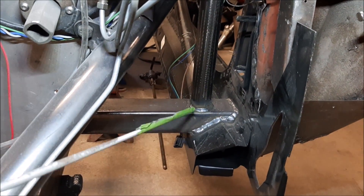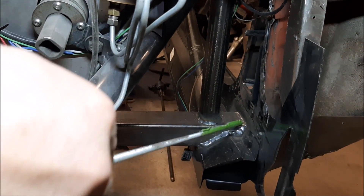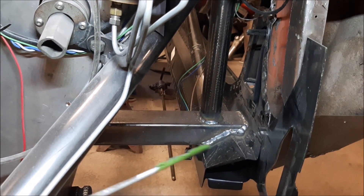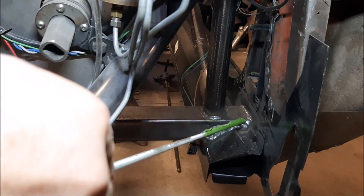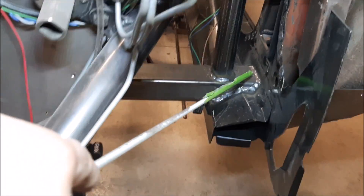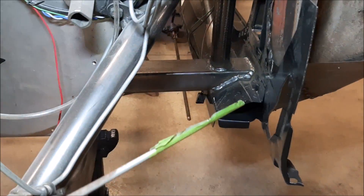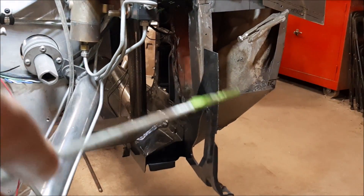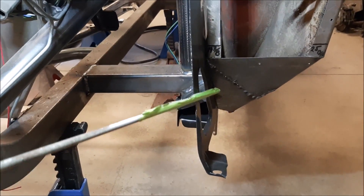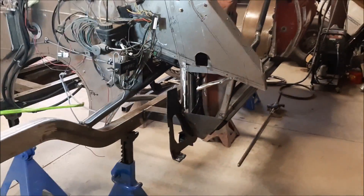You can see they've got this custom roll bar — we basically reinforced with stronger tubing, cut the angles perfect. The guys made patterns to match this rocker exactly, and then once we had that all fitted in, used extremely high heat. Incredible job on the welding for structural support. We have this outer piece — which in the earlier video was all just cut off. This is an essential part because there are bolts that go through there, and that's where we're going to fasten the inner and outer fenders for mounting points. So this is the front of the driver's side.